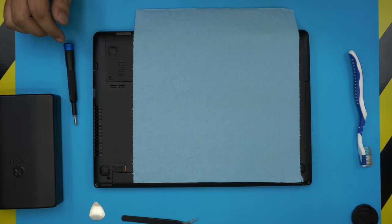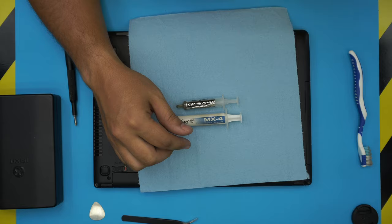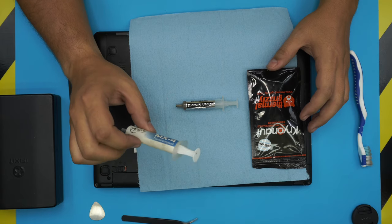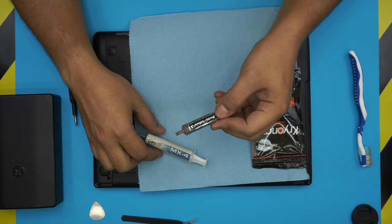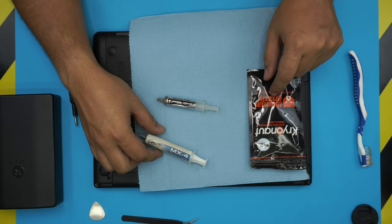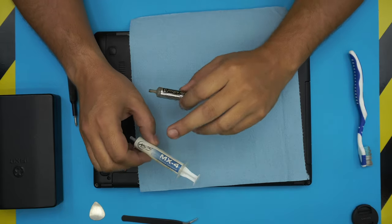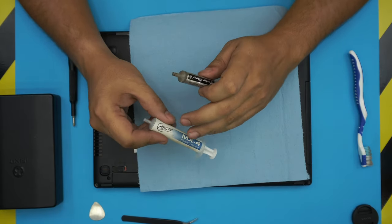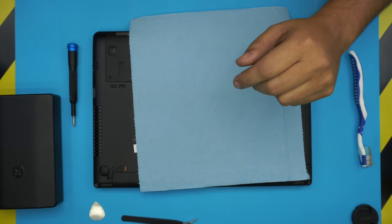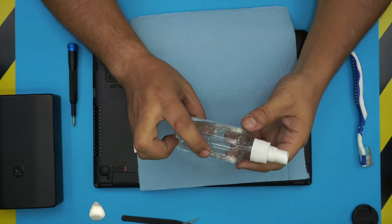The most important part would be thermal paste. Depending on your budget, I recommend the Arctic MX4 — these are really good. If you want to go a little cheaper, you can go with Arctic Silver 5, which is still good. You can go overkill with Thermal Grizzly Kryonaut, but we're not using that here as the client just wants Arctic MX4. We also need isopropyl alcohol, 95% or higher, not to drink — just to clean up the old thermal paste.